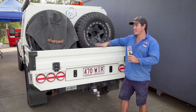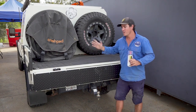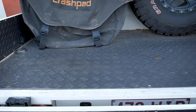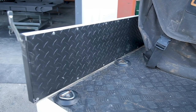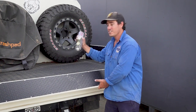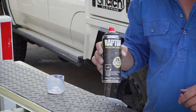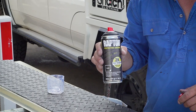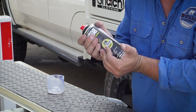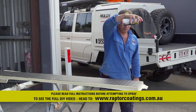I've had this half-tray canopy set-up on the 79 for about 12 months, and in that time I've been to the Simpson Desert, Cape York, and Fraser Island, plus I use this as a daily driver to carry a lot of stuff in the back. I used Raptor liner in here because it's a really tough protective coating — in fact it's five times tougher than your traditional automotive paint. You can also touch it up with an aerosol can. Shake it for about two minutes; there's Raptor liner inside and a little hardener bag. Push the plunger on the bottom to pierce the bag of hardener, give it another shake for about two minutes, do a quick wipe-down, and then you're right to paint.